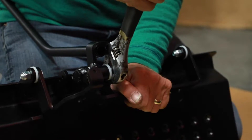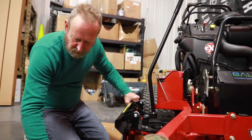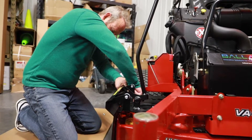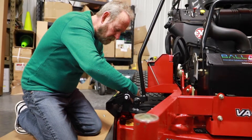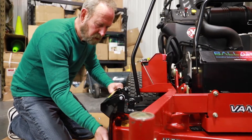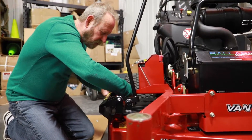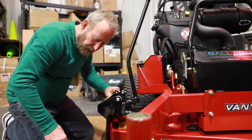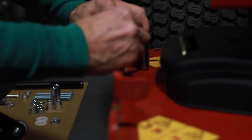We've got the handle installed on this model. The 48-inch battery box may get in your way if you try to set it back too far. So at this point I want to make sure we have room — we're going to mark the holes. We're going to check the back one and make sure we've got clearance. We don't yet, so come ahead about another quarter inch. Make sure you get your spacer in here, going just to the height of the factory mounted brackets. We've got it sitting right on there — I'm going to remove this, mark it, and drill it.